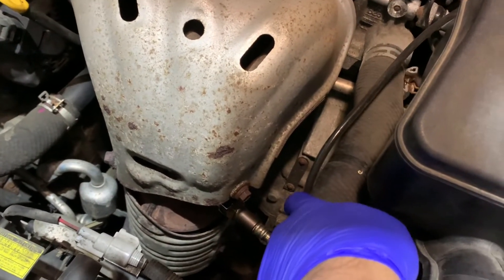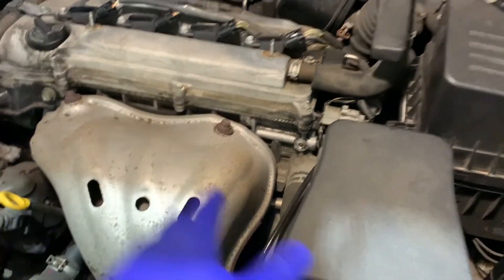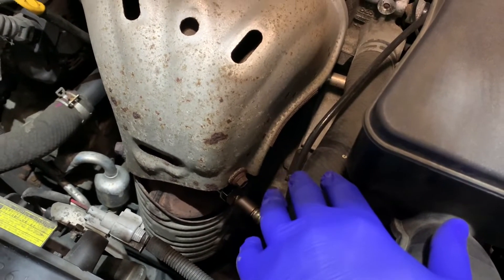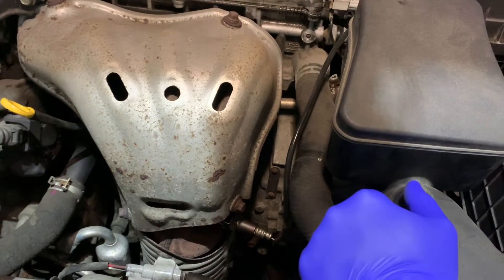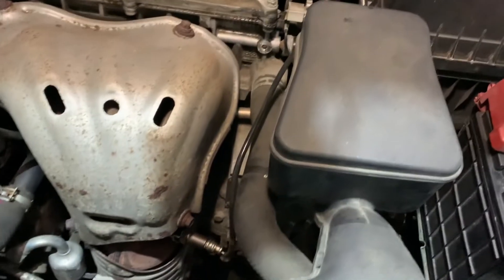After checking the air intakes and vacuum lines, we want to check our O2 sensor — bank one, which is up here. This car only has two of them: one is upstream here, and one is downstream right by the catalytic converter under the car. I'm going to go ahead and open that up, see what condition the oxygen sensor is in. That could be one of the problems causing the code and the engine light. If that doesn't resolve the problem, then it has to be the fuel pump.